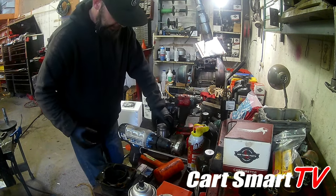All right guys, there it is — all finished up, cleaned up as good as I could get it. It was pretty caked up with grime from the two-cycle oil leaking everywhere. The old gas tank had a leak in it — I had one out in my junkyard that was still good, got it all cleaned up and put in. Pretty simple to do — just undo your strap and your bolts, a little finagling to get it up and out, and it comes right out. Now it's time to go back in with the engine.